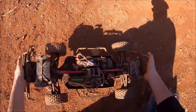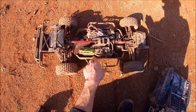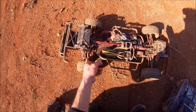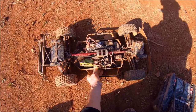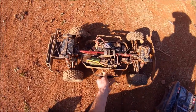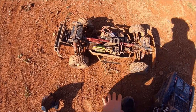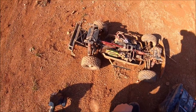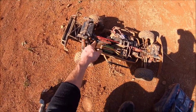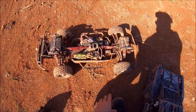Everything else on the truck looks like it held up nice. The chassis is still straight — this is the stock EXB chassis. I'm still not 100% happy with my overall suspension setup running such a heavy electronic system. The thicker shock oil — the 55-weight — definitely dampens her nicely and she's butter smooth, but I just need a little bit more rebound, especially in rougher terrain so she doesn't just sit there and plow the ground. We'll play around with that, and we're also going to be working on some shock caps and a piston setup specifically for the Mojave with M2C Racing.